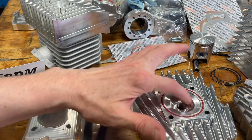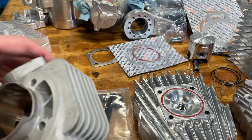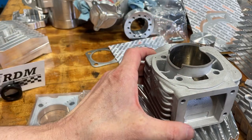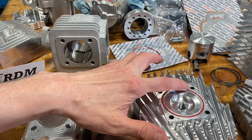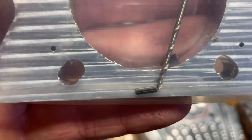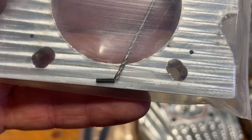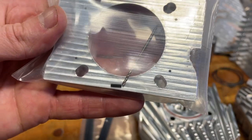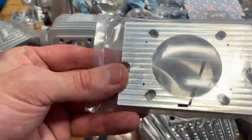For many reasons, we want the head perfectly centered with whatever cylinder it happens to be bolted onto. To do that, we have these little short holes drilled. As you can see in here, those are slotted pins. That little slot in the pin allows it to be crushed in to a smaller pin size, fit in the hole nice and easy. Because it holds tension, it's like a spring-loaded pin — it really keeps everything firm and super precise. That's the correct size drill bit.